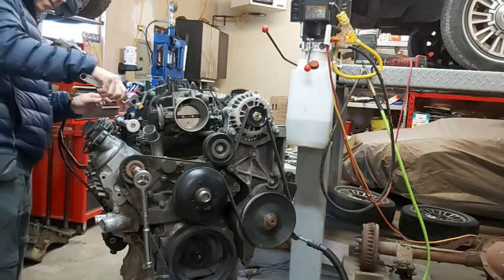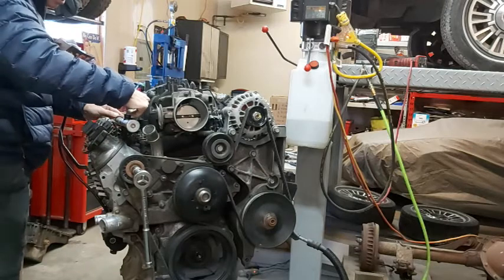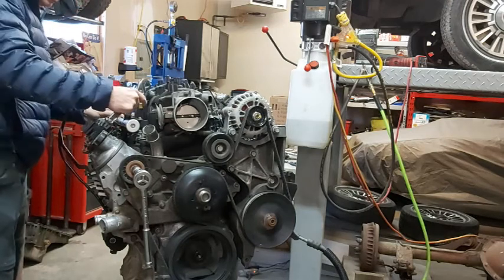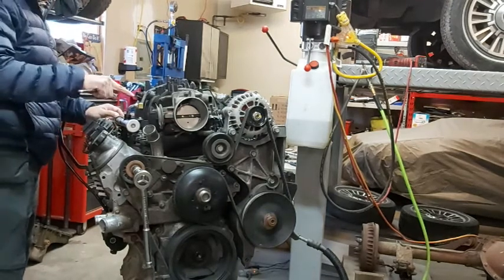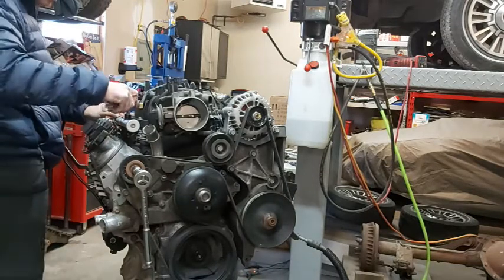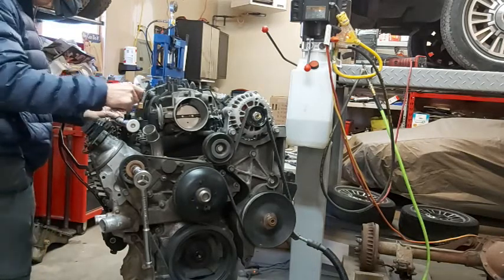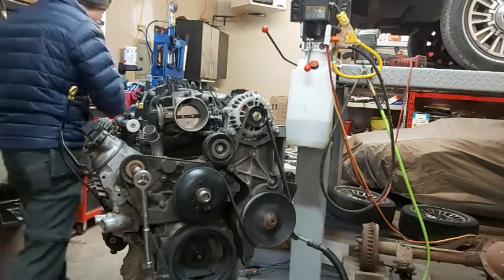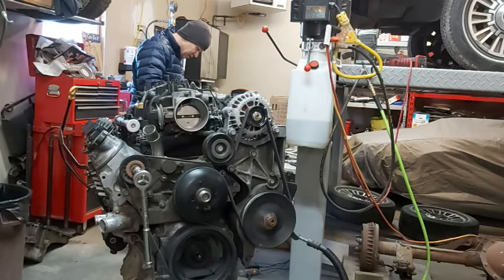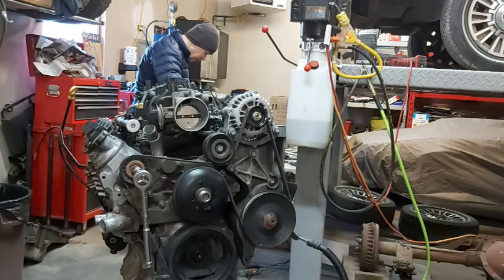You want to kind of rotate it towards the angle where you can see the gauge clearly. You want to make sure that this is really sealed really well, because you don't want any leaks on your intake going onto your hot exhaust. A little more paste on our threads here — this is a high-temperature, high-pressure thread sealant paste, by the way.